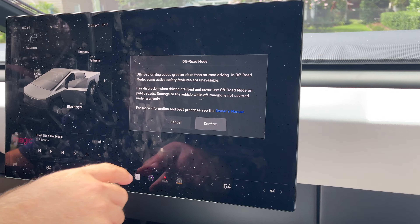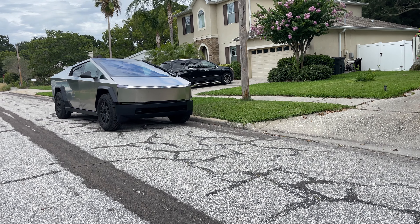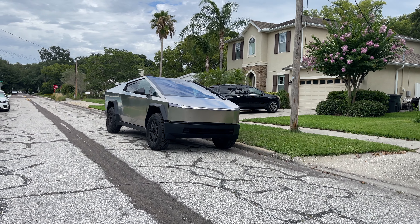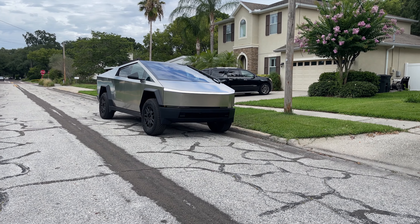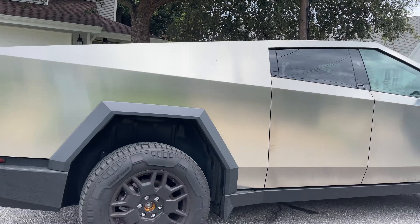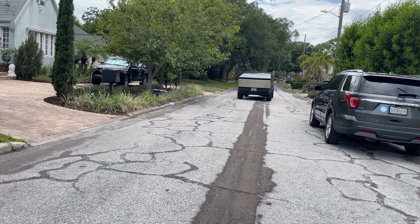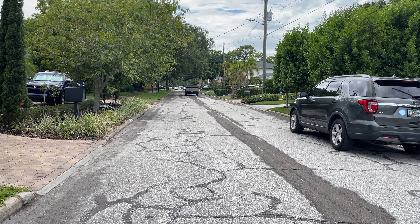It's got an off-road mode, and I think there's some kind of trail assist where it just goes at a steady speed. I definitely feel like the air ride kicked up a notch — it felt like we got taller when off-road mode came on. If you're not in off-road mode and you're on the high setting, once you reach 25 miles an hour it'll go back down to the low setting. But if you're in off-road mode, it'll stay in the highest setting no matter what.